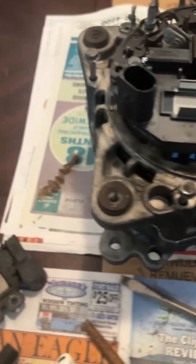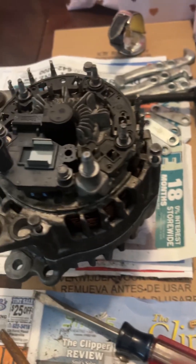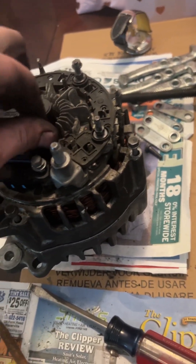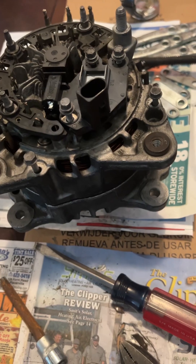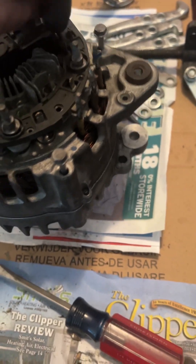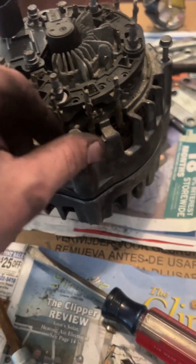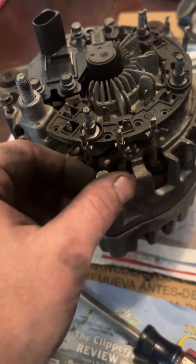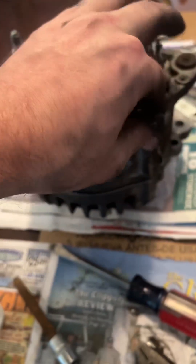This is just kind of a quick down-and-dirty emergency repair that had to be handled as quickly as possible. Almost done — putting her back together. The perimeter bolts are 8mm and the internal bolts are 7mm. What's cool is the 2.0 TDI case halves do actually split without having to cut these wires — that's probably the biggest reason I made this video. This is the Valeo 220 amp alternator. Goes together real quick, comes apart real quick. Save yourself a lot of money with a very minor repair.